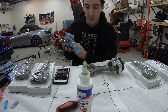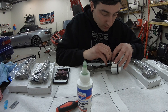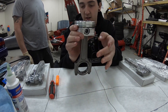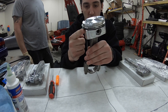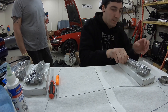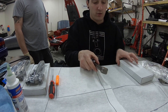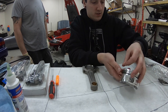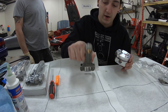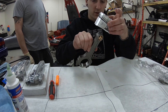Chris came through and saved the day — showed me the easy way to get it done. So the first one is completely done. There's no binding, nothing — everything slid together good. Assembly one is complete. Now we should be able to do number two, three, and four quickly. Now that we know the better way to do it, we're going to do two. So we're going to start with c-clip number one. The bearing retainer notch goes in the back on the exhaust side, and the bigger reliefs are the intake, the smaller the exhaust.